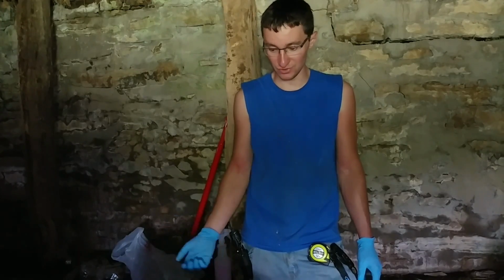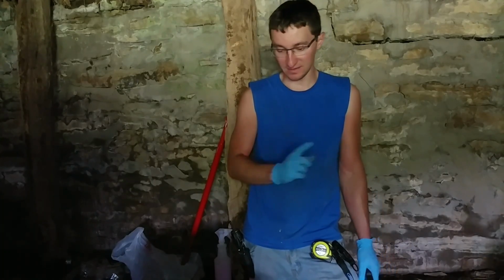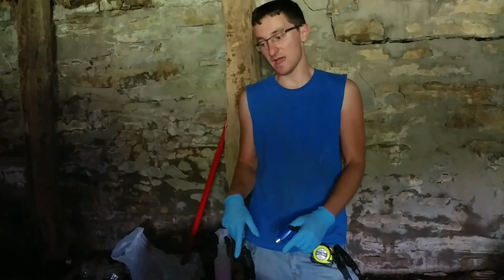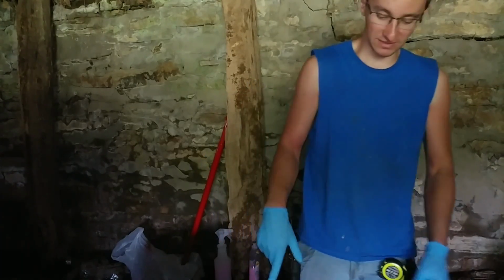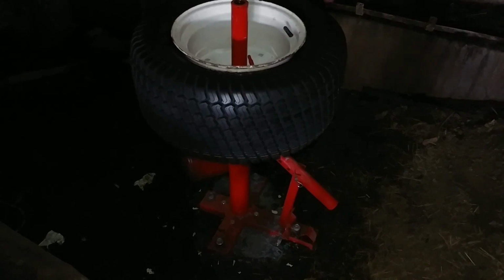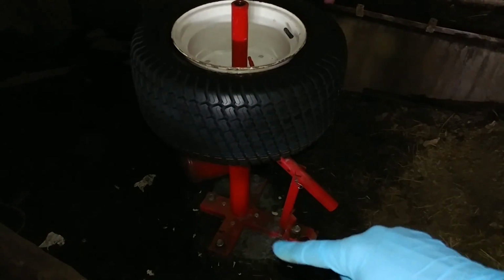And I did this in an afternoon in one day. Didn't have to call anybody or anything, and didn't have to take them anywhere. All I had to do was go from one building to this one where my tire changer is bolted to the concrete. I would highly recommend anyone that is putting this tire changer in, bolt it to concrete, bolt it to something that will not move to use it. These are 1/2 inch, 4 of them, 4 bolts holding this down.